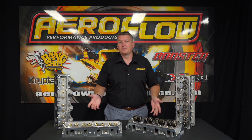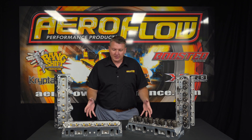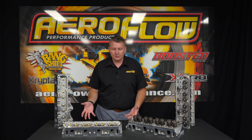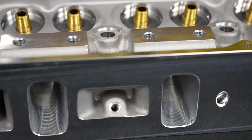A lot of people don't consider that fact, but show me something else that you can just wipe 20 pounds off the front of a car without having to change anything drastic. That's a byproduct of the alloy cylinder heads, which is one of the reasons why it's such a good point to go to an alloy cylinder head when you're doing a rebuild or building a fresh motor for your street car.